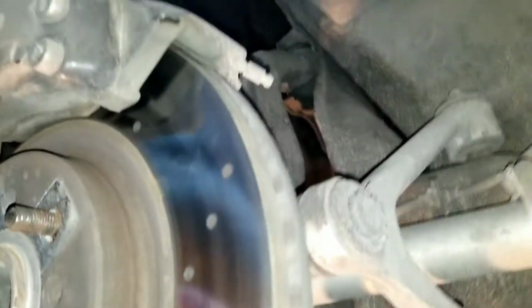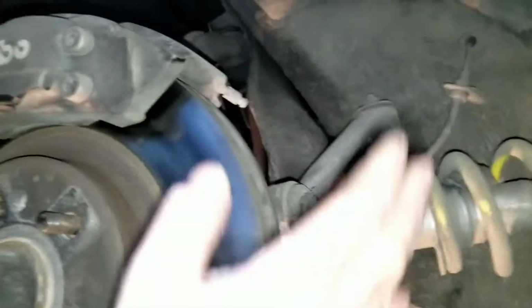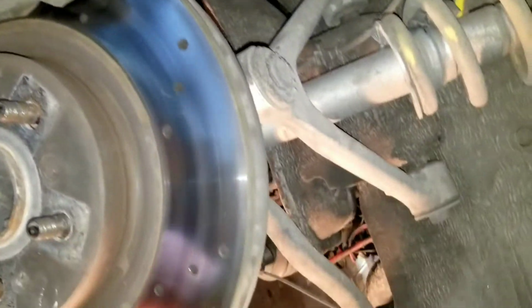So I'm going to get started on all this. I don't think you really want to see the work that's going into the start of it. The rest I'll show you after. I've got to check my brakes on this side because I noticed the left is pulling harder than the right, and these are the Brembo Mercedes big brake kit modification, so I don't know what's going on in there. I've got some new pads for it. The rotors look pretty good. So anyway, basically it's a systematic taking everything apart to get that control arm off. And then possibly this one too, when I look and see what's in my kit. Taking about 10 minutes to do this, but there you go.